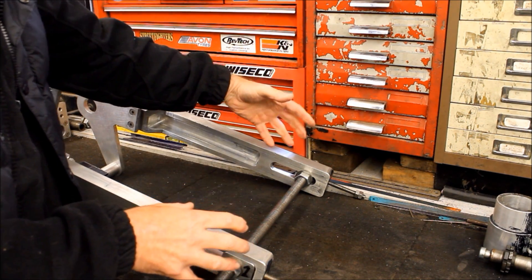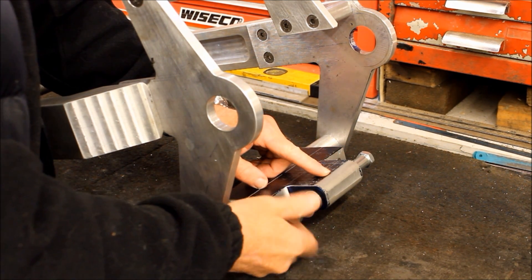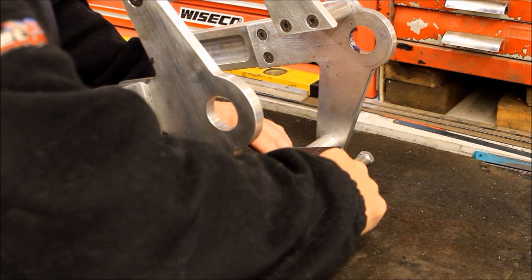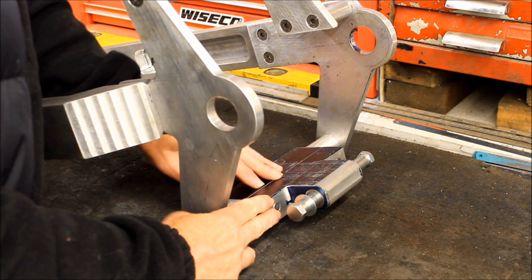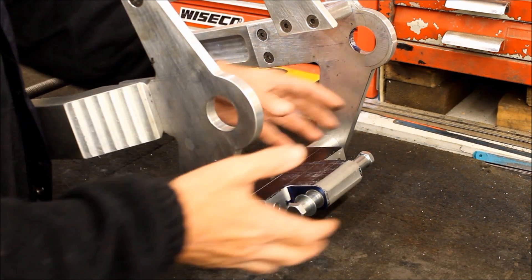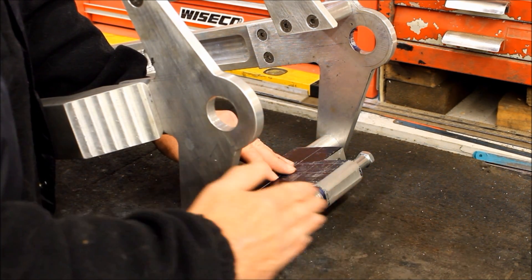Looking at the front of the swing arm, the holes for the shock mount bolts have been drilled and tapped. These are not metric - they're imperial, I think half inch - and these bolts are special shoulder bolts so that when you tighten them up you won't crush the shocks, which go forward beneath the gearbox. We also lost some weight here, made it as light as we could. This piece is actually bolted to the back piece - on the original steel version it's one big steel piece, but we've done it in two pieces so we can shim it and move it forwards and backwards to alter the ride height.